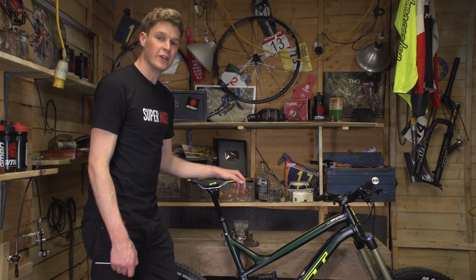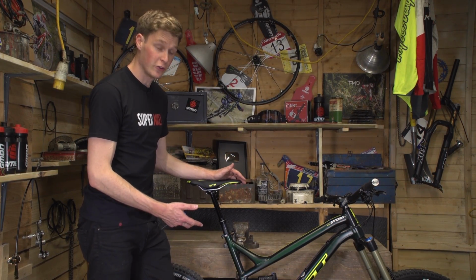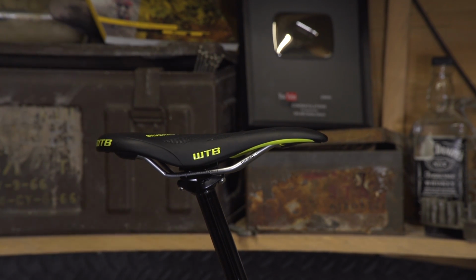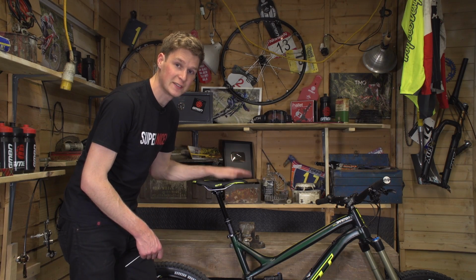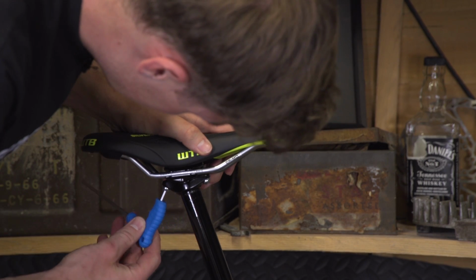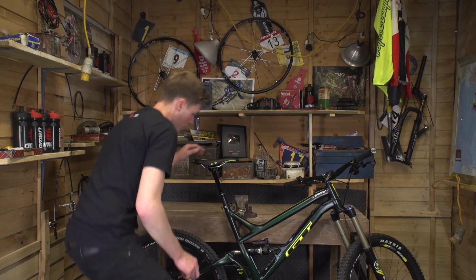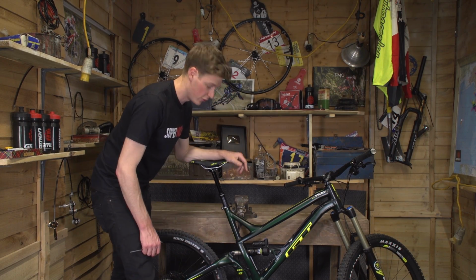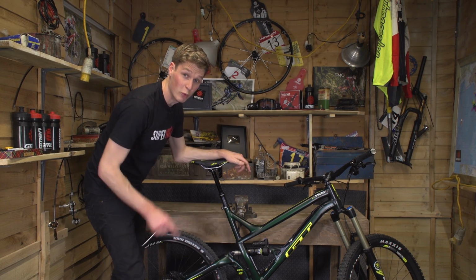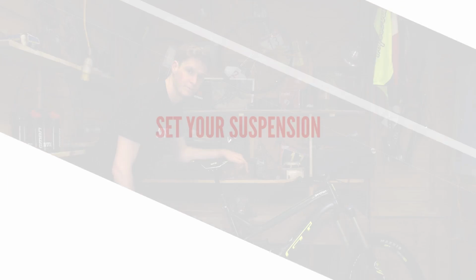Now, one of the things that really makes a big difference to how I feel on the bike is the seat angle. This is an enduro bike. I like to have it at a slight angle with the back down and the front up just a little bit, but not too much because I'm still going to be climbing on the bike. So I try to keep it quite neutral so it's comfortable on the climbs. All that's left to do is set my seat height, but we've already got a video on that, and the link will be in the description down below.